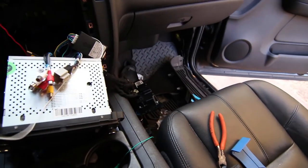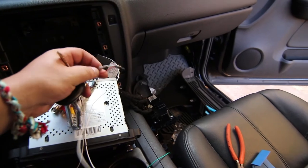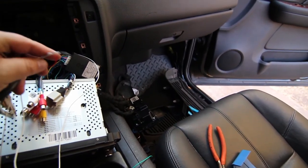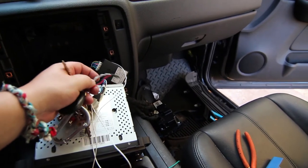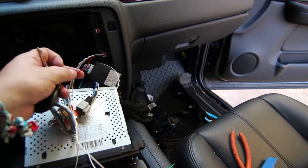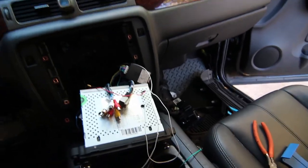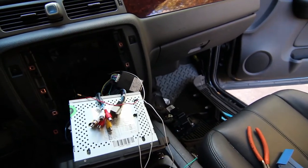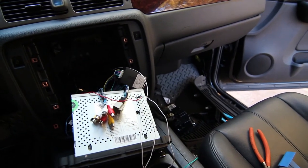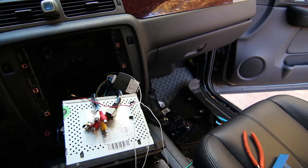We got a little housekeeping to take care of but that's pretty much it. What you see right here — this wire goes back along the video line to the backup camera, and all we do is jump in here so whenever I put it in reverse both of those side lights will light up. I've had this head unit out probably like a dozen times by now so it'll go back together pretty quick, and then I'll give you guys a demonstration of all the features.